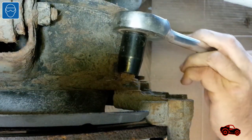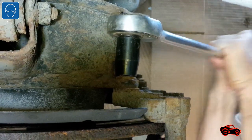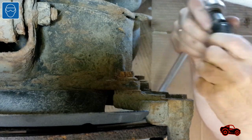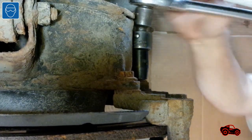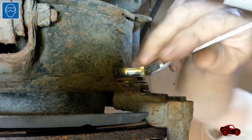When the caliper was secured I used a big ratchet with a 13mm socket to loosen the two caliper bracket retaining bolts. A breaker bar can be used if the two bolts are too difficult to unscrew. To unscrew the lower bolt I used a universal joint because the space was too tight. The rest was done with a small wrench.